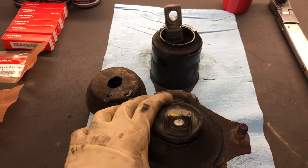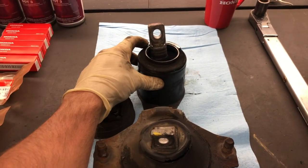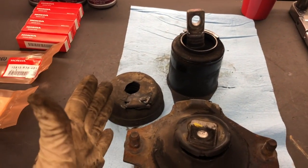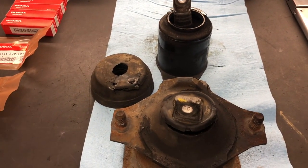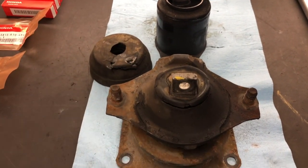So if you neglect these two mounts, it usually starts with the front mount. If you neglect that mount, it usually causes the passenger side mount to fail. And if you neglect these two mounts too long, it'll go to the back mount and it'll start to fail, and then on to the transmission mounts. So you want to address these before the expense of the repairs adds up.